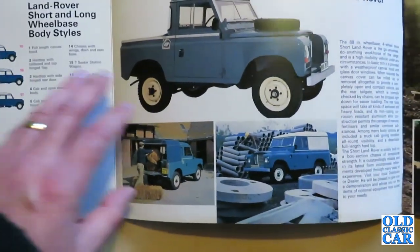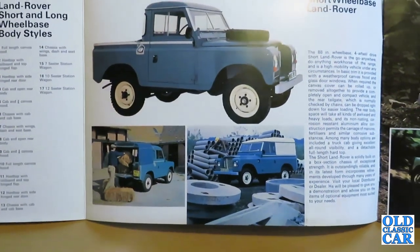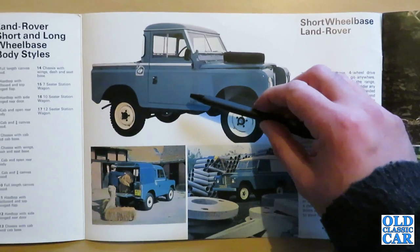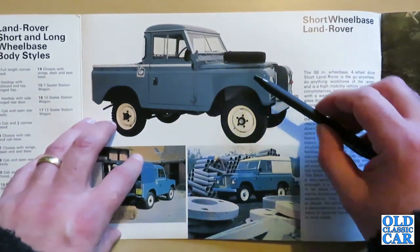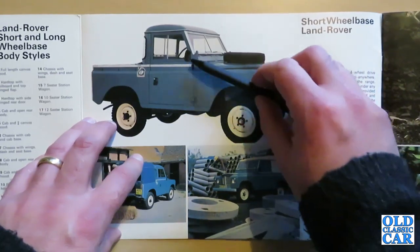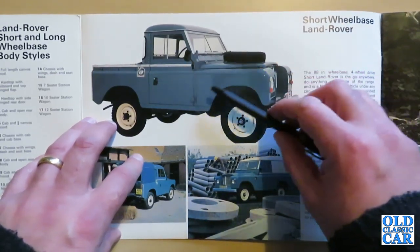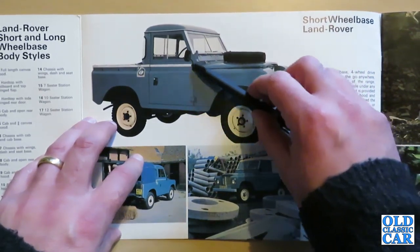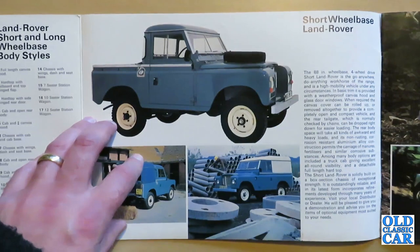It's just a shame that the chassis used to rust away so badly — at least in later years if not straight away. The chassis is probably the biggest weak spot of any of the classic Land Rovers. The body was mainly in aluminium but the bulkhead was steel. If you look at any tired Land Rovers now, if they've not snapped in half they'll be rotting where the door hinges are and below the windscreen — that's where you have to check them out.